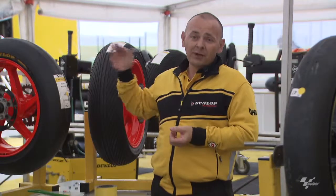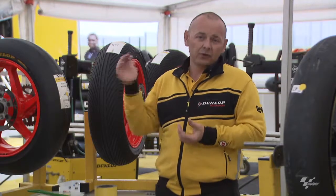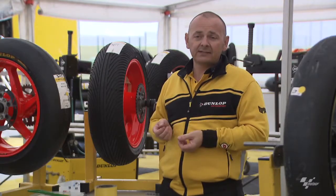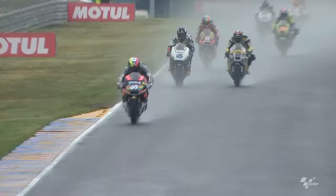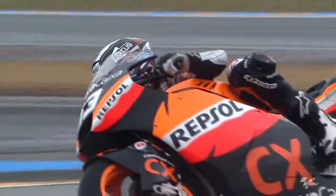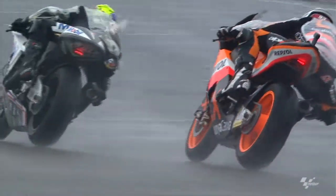With the slick, if we're going below 80 degrees temperature, performance drops and they're not really on the pace. The pace difference is about 10 to 15 seconds from a slick to a wet on individual tracks. In wet conditions, if you don't feel any movements on the bike you can push, but you have to be very clever. You can improve more entering the corner than leaving it, because leaving you can slide suddenly — but the front is quite good, so my technique is to win time at the beginning.